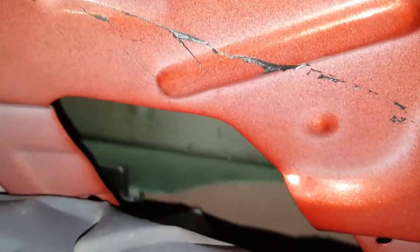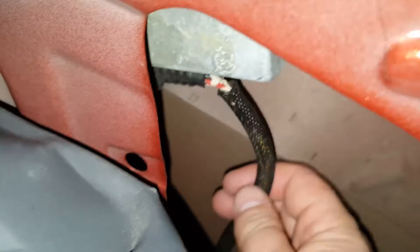That's the inside of a PT Cruiser window with the window motor. Like I said, a lot of times on PT Cruisers, this wire right here will go bad. The car's on so I've got to be careful — this wire actually frayed and went bad, and it looks like it's about to do it on this one too. That's what went wrong on my car — just that simple little wire, and the dealership told me I needed a new motor.